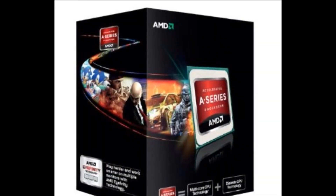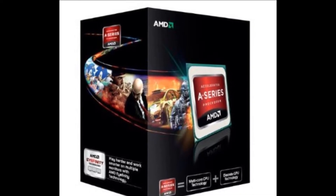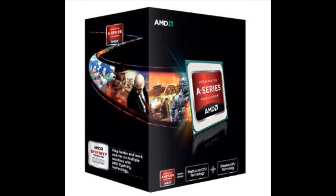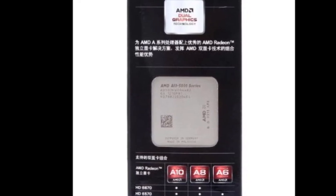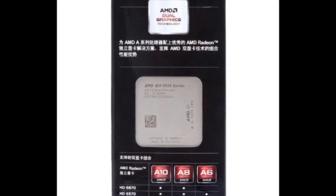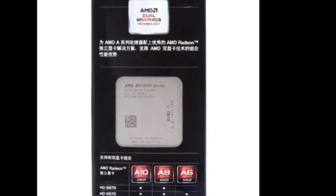What up guys, it's KP coming in with a $400 computer budget build. In this build we will not be using a graphics card, but rather an APU unit. The AMD A10 5800K fits in just nicely — it's a monster of a processor for its price point. For $120 you get a quad-core CPU running at 3.8GHz with a 4.2GHz turbo boost, and it's unlockable in case you'd like to get a better heatsink and overclock it later on.